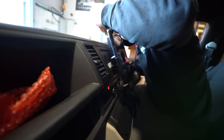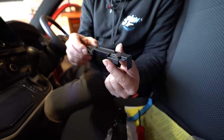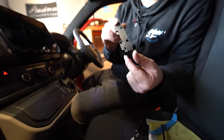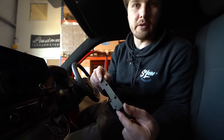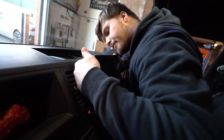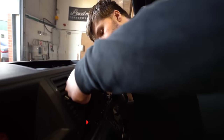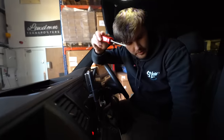I've grabbed all the fixings for the screen. Coming around the back of the radio, you've got six threads for the two screws that secure the screen. The next step involves these two small screws and a plate — if you don't fit this plate the radio will not work. It basically confirms everything is secured, and then it'll power up. It goes around the back here and you can tilt the screen out of the way a bit. With those two screws and that plate installed, the installation is now done.